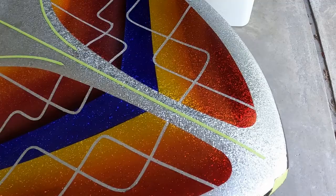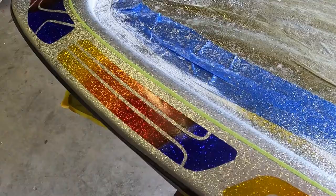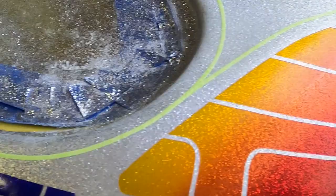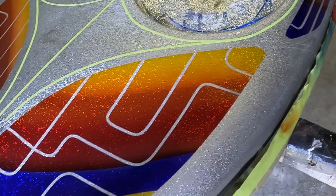Started taping out the pinstripe graphics, just going through this portion. The green tape is going to stay flat, and then I've got to back tape all these — it's going to be quite a bit of work, but it's not a big deal. It's part of the gig — it's how you get good looking work. You've got to do all the steps. Once we get that done and have it masked up, we'll get it sprayed black on the top side.